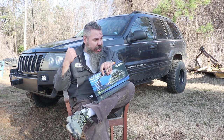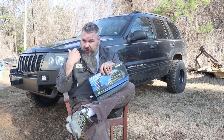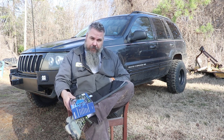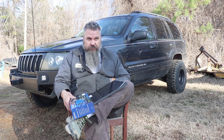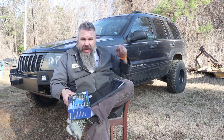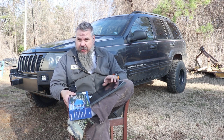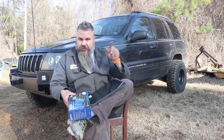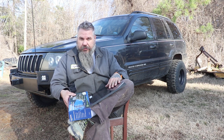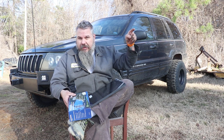We've already installed the antenna and the cable. I'm not going to go through that. Just installed the antenna through the bumper there, and ran the cable through the firewall. The main grommet is over here on the driver's side. I went under the main grommet and drilled me about an inch hole because you got to feed that big cable through there. And I installed a grommet, ran it through there. I also ran the lights through that same grommet, and I had to have lights go through there anyway, so we went ahead and did that. Routed it through the dash up to where the radio is.